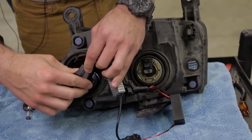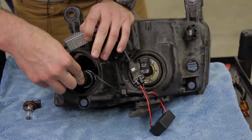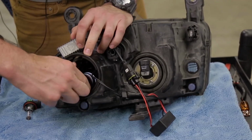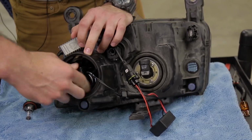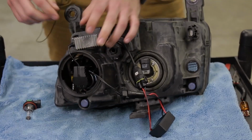Now, this bulb does require that you rotate the collar 105 degrees in order to get that vertical alignment that you want with the LED chips. If you have any questions at all about how to rotate the collar on the SL1, the link to our collar rotation instruction video is in the description below.